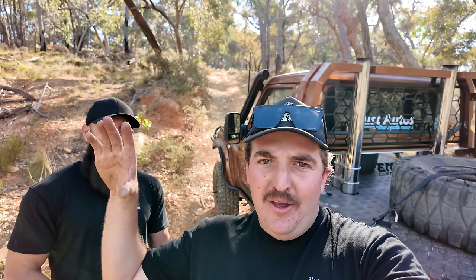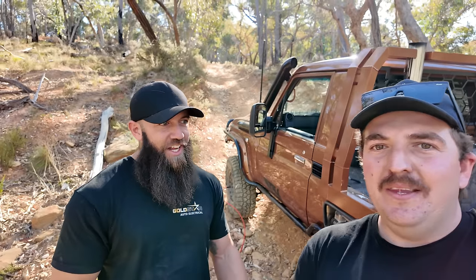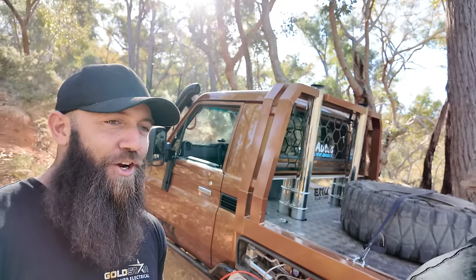That's exactly right. Another thing with these Second Air beadlocks, the boys were saying, and it makes sense, is they're taking up 20% of the capacity of the tyres. You would have seen that earlier when we had the cutout tyre. The tube actually takes up that much of the tyre and the rest is what you've got to air up and let down. If you took the volume of all four of those tubes, that might equal one whole tyre. So instead of having to air up four, you're airing up three, technically, in terms of how long you're going to wait. That ability to air up 20% quicker is what matters when you're trying to get to the pump.